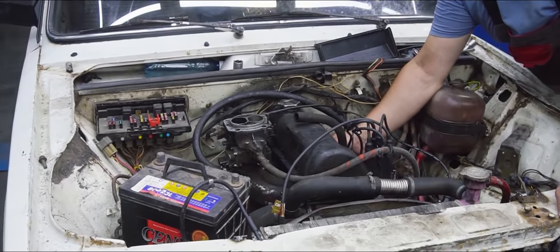Now let's look at cylinder number four — that's the one where we had the big balls. So here's what happened. Remember the first time the engine seized? Three balls were resting on the piston, and it looks like they hit the head simultaneously — they sort of even look like factory markings. Now I'm just starting to clean this with a rag — notice how clean it is already. The valves are beat up, but you can barely even notice it. Next to the intake valve you can see that something slammed into the head with quite a bit of force — those are some nasty marks.